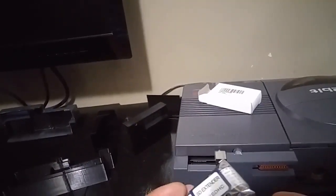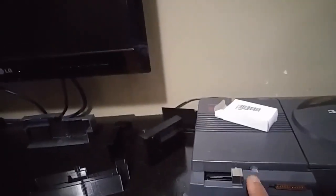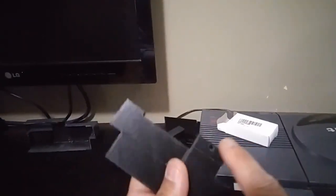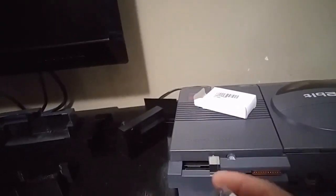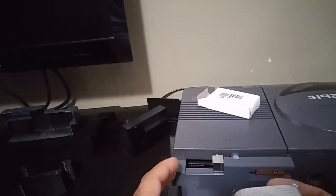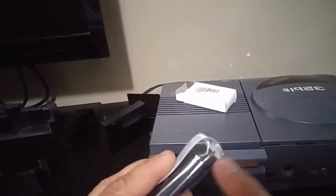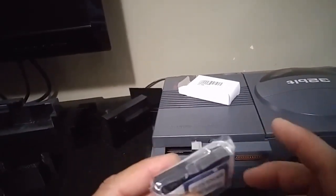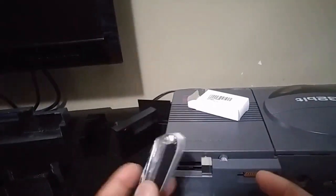It's one of the things I don't like doing — continually unplugging and plugging the riser from the edge connector. It just feels like it's going to wear it out. Adding unnecessary wear onto this machine is never a good idea. With the hole I'm putting for the bolt to secure it, I don't want to have to take the bolt out and everything else. Really the only thing I need to open this up for, once I've installed the TF330 in there, is to change the SD card or update the image on there. So I thought an external reader would be great.